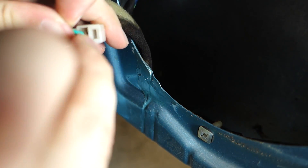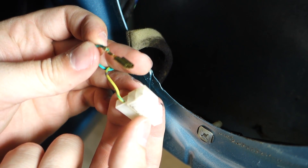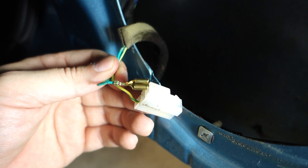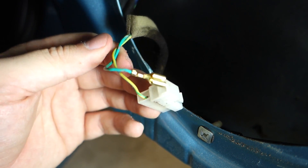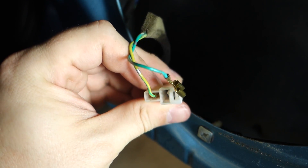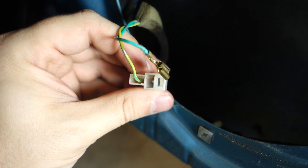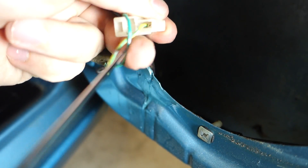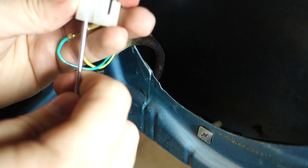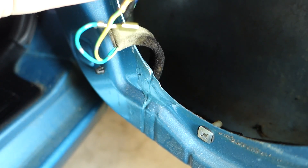I've rotated it a little bit — there we go. By not damaging it, I've pulled that pin out, and now I can use that on the speaker directly since it's the correct size. I just need to repeat for the bottom piece, which is the same way — it's got that same little clip hanging down. I'll go ahead and do this really quick. I just have to get deep enough to push it up, slide in backwards, and there we go — it's free. Now we have this connector set aside and we've got the two spade pins.